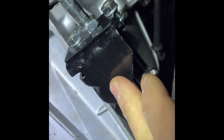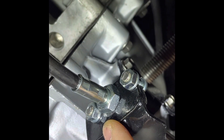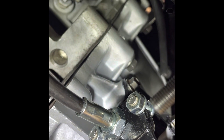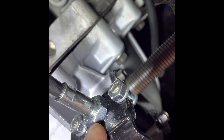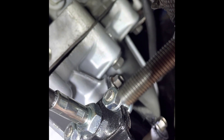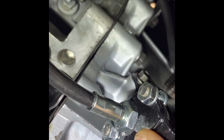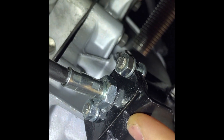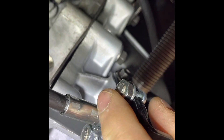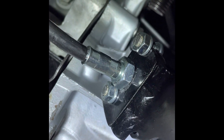This was the original bracket that was on the transmission. What I did was take pieces of sheet metal and basically make these two plates so I could drill a hole and thread the cable through — because the hole that's actually in this bracket is too big and you don't have anything to bolt the cable to. I got one plate on the front side and one on the back side, and the bolts go through to hold it together. Then I just drilled a hole here to allow you to secure the cable.